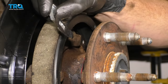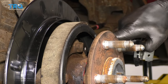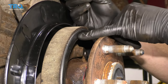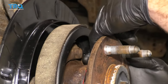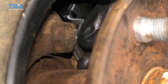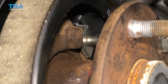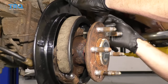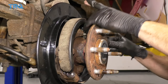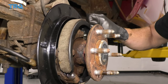Now it's going to be time to get the mounting bracket on there — it's a kind of funny looking thing. If you look at it, you'll see it has an indented area right here that's going to ride right on this bracket. You want it facing in this general direction so that the black part is riding up against the inner ridge of this shoe. Put it up on there, line up your screw hole, and put in your screw. So that's pretty much bottomed out right there. You definitely don't want to go too much further because it is just a very small bolt, but you also don't want to go not tight enough. Once it's bottomed out, just give it a teeny bit more and make sure it doesn't feel super loose. Give it a nice little wiggle — make sure you don't see any movement between this and the bracket itself.